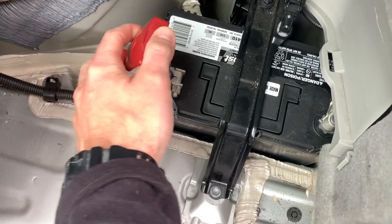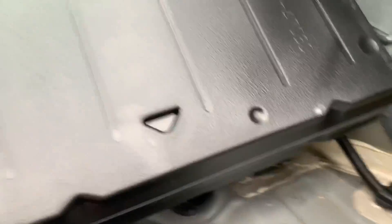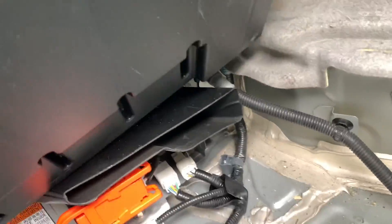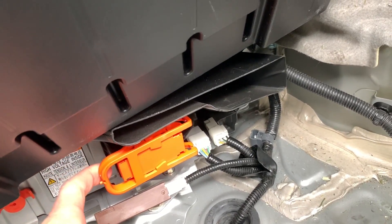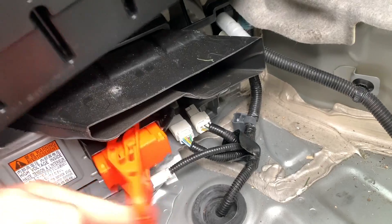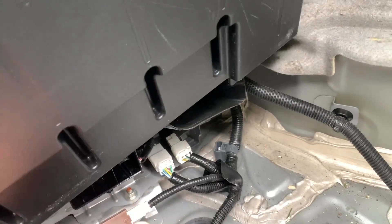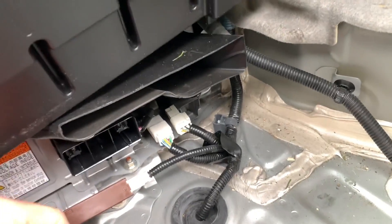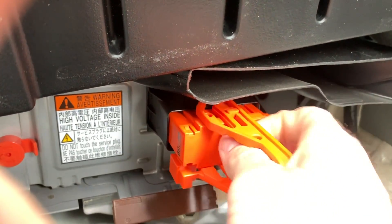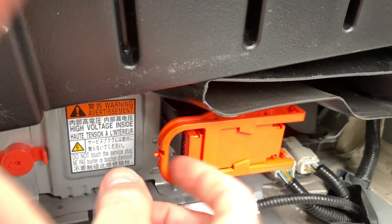This is new — I replaced this and the car still wouldn't start. So you can reset this. This is the main battery fuse. All you do is pull this out and then let it sit for a minute. Obviously if you want to go anywhere you need to put it back in — push it in and then over. That's how it works.